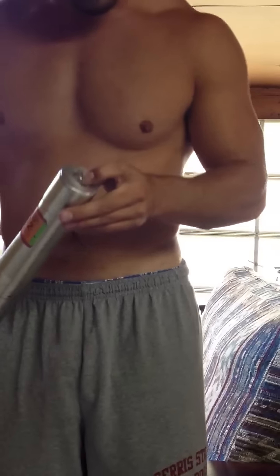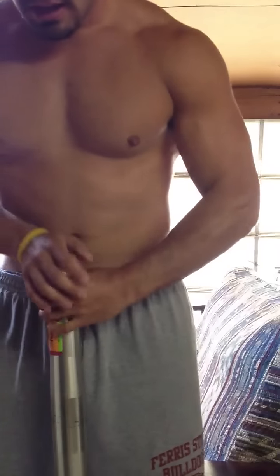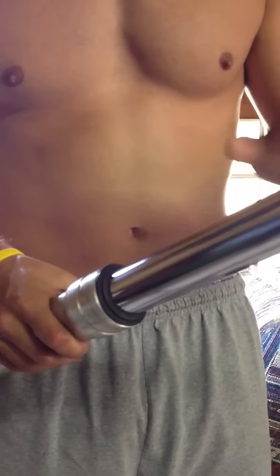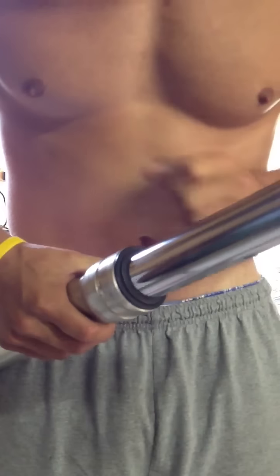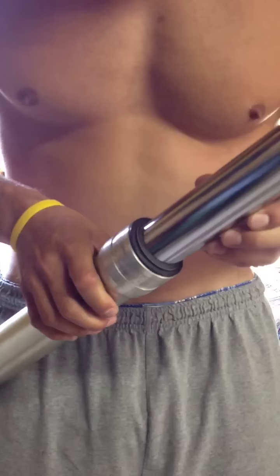I have these set on two clicks from as hard as possible, and I can compress them almost all the way. You can see there's oil on the shaft. Seals are leaking, and the dust seals are pretty much shot. There's dirt, and the rubber has looked like it's dry rotted off.